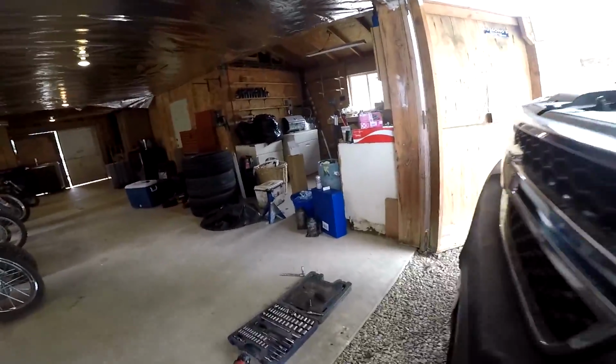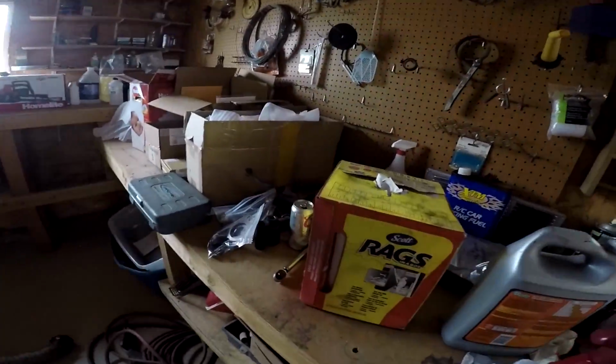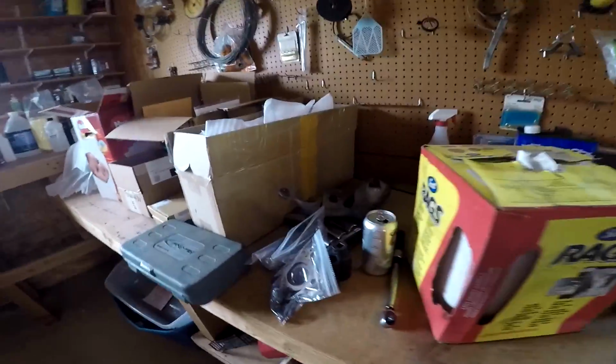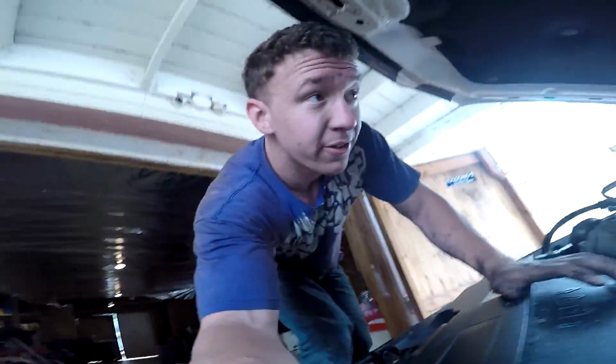Alrighty, the driver's side up pipe is out. Well, it's still sitting, I still have it resting in there, but the heat shield is out. That's really what you gotta get out. I don't know what I did with it. It's right over here. The heat shield itself, I pulled it up from the top. So you just gotta loosen it all and pull it up from the top, and it's fine. Once that's out, you can lay the up pipe back far enough.